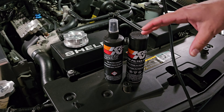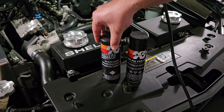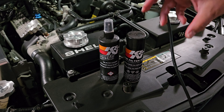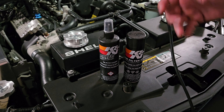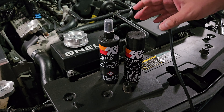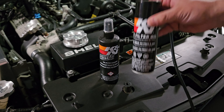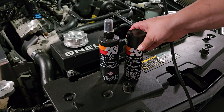Today on my reusable filter, even though it's not made by K&N, I'm going to use their products to help in the process — just a little bit of the air filter cleaner and the air filter oil. This is what most people are concerned about, and rightly so. The problem is if you put too much oil on your filter, it will get on the mass airflow sensor, it can get up in the throttle body, and it can be problematic. That's why a lot of people don't want to re-oil the filter. I'm going to use this, but I will be using it sparingly — just barely enough. I do not want this stuff getting on the internal components and messing things up.